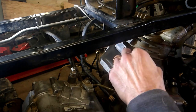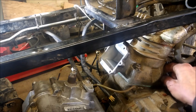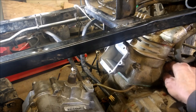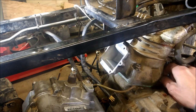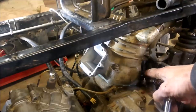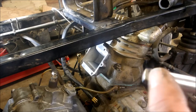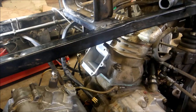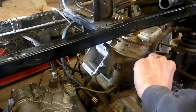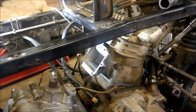This one down here is a bit of a trick. You want to tighten them down in a crisscross pattern. For this one down here because it's such tight quarters, I've got an extension with a beveled edge and this thing will actually rock on it, so I put that on and I can get in there and tighten it.